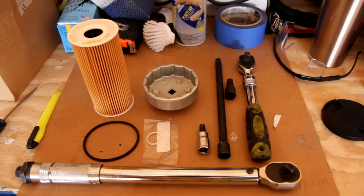Today I'm going to be showing you how to change the oil on my 2010 Porsche Cayman. It's pretty straightforward — just lift the car and place it up on jack stands. If you want to use ramps and lift the rear end, that's okay too. Once you have the car up, undo the drain plug bolt and the filter housing, let the oil drain, put the new filter in, torque the housing to 19 foot-pounds, put the new drain plug in with a brand new crush washer and torque that to 37 foot-pounds, then top up with oil. The car takes about eight and a half quarts, so I buy two five-quart jugs. I'm using Mobil 1 0W-40, the European oil.